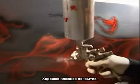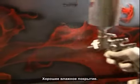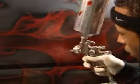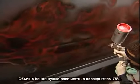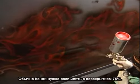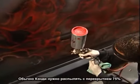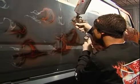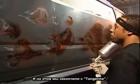One wet coat. Any area that you do want even, just a nice even wet coat. Usually candies are 75% overlap from one pass to the next. And that does it for the tangerine.